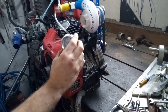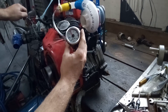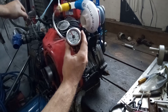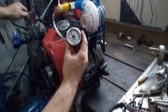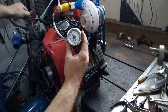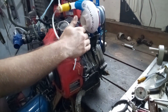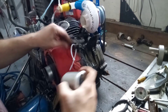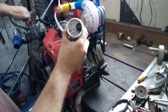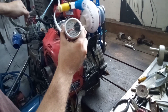With the new pulley, everything is extremely loud — it's like I hit a threshold and the supercharger is really making a loud whistling noise, especially dead-headed like this. So much so that my microphone is not very happy about it. A quick pressure test with the less accurate gauge seems to be about a 2 PSI bump, and switching to the slightly better gauge it seems to be about a pound and a half.